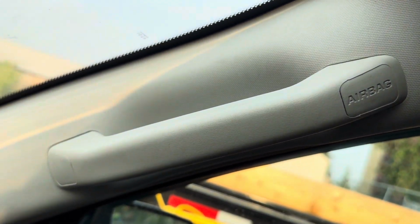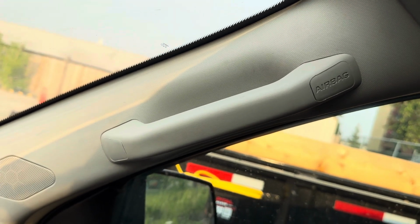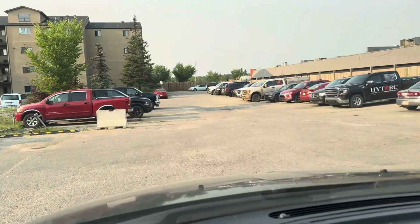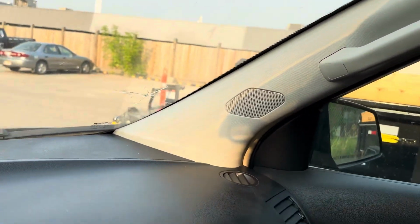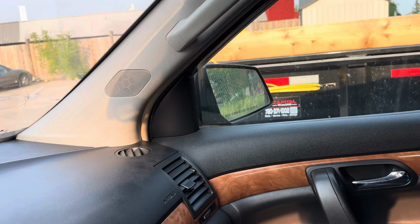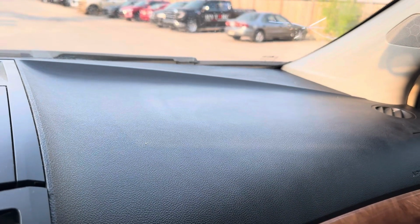And these two screws that are in there are a 10mm socket. So after you remove the sidings here and disconnect the small connector for the speaker, and then you can remove those two, you will see the water drain line all the way down there, close to the frame. Inside there, when you remove this top cover, it's connected that way somewhere. It's very tight to see. So you have to remove it.